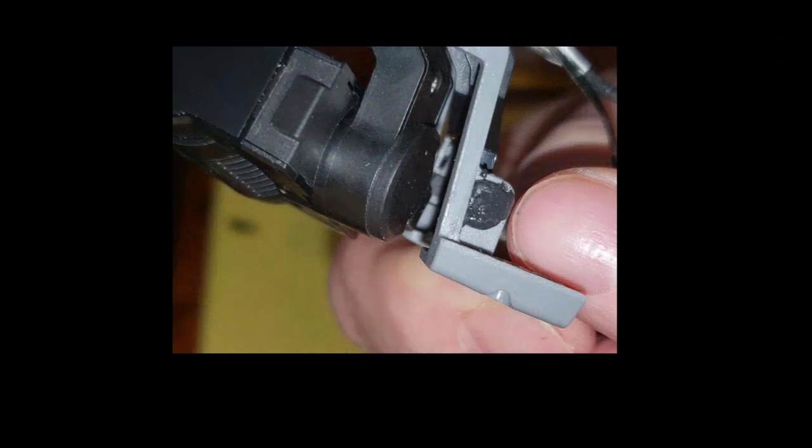When I went back over this video, I saw this little snapshot here back around 1420, 1425, I think, in the video. And the only thing I can think of is that maybe this grommet, maybe it's damaged, and maybe it's preventing the gimbal from operating properly. That's the only thing I can think of. But in any event, the gimbal's no good, obviously, because the old one I put back in had no issues, no problems. Same as it was before, and when I put the new one in, I heard that buzzing, that grinding noise.